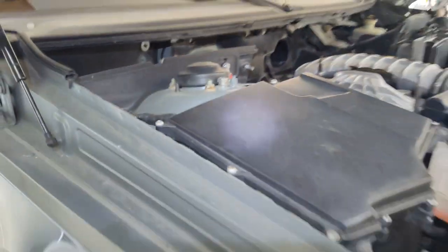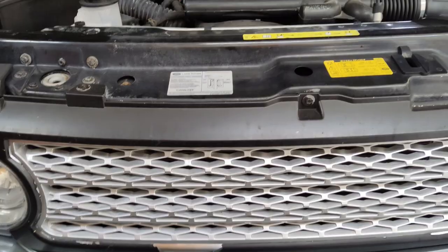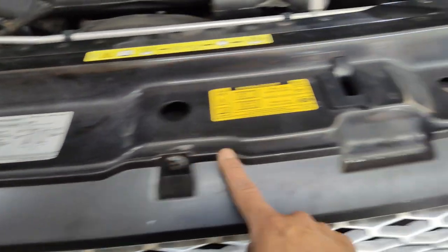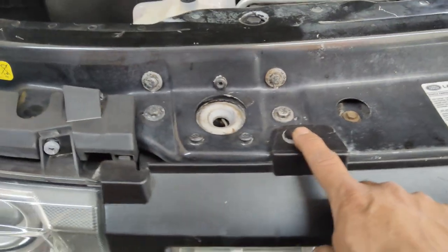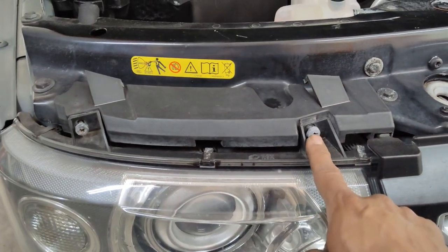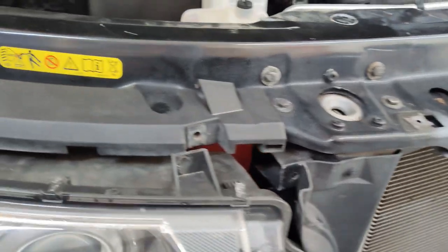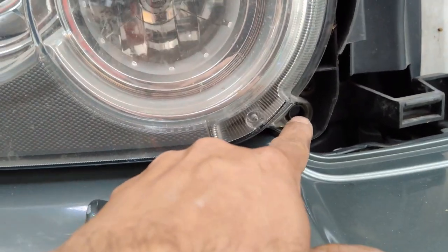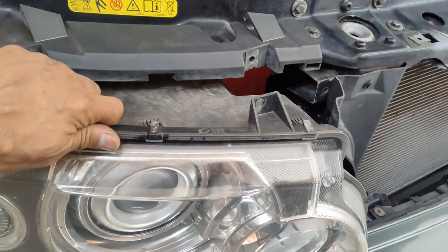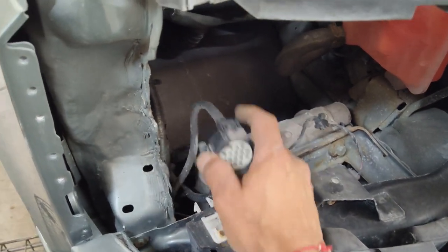I have the vehicle in off-road mode so that gives us access underneath to reach any bolts or belts we need. We'll start by removing the grille — there are 8mm bolts here in the front up top and also on the headlight there are Phillips screws. On the headlight there are two Phillips screws, one on each side, and at the bottom there is a 10mm bolt. Once you have those removed, you should be able to pull the headlight completely out. Disconnect the wiring in the back to completely remove the headlight.